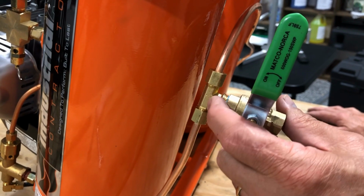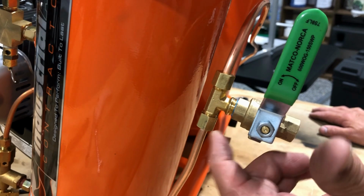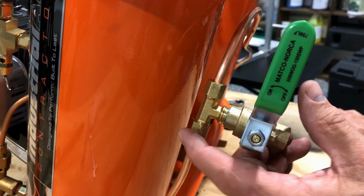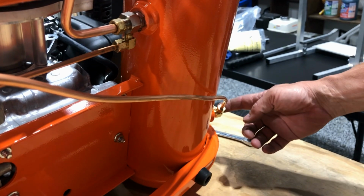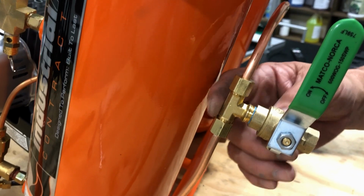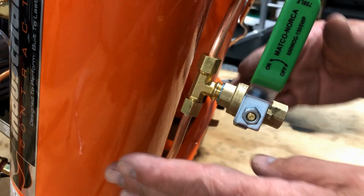This is going to be the hardest one to find. Sometimes you have to look for these, but this reduces the number of fittings. So this threads right into your 1/4 inch valve, 1/4 inch by 1/4 inch tubing. These are compressions, and then, like I said, the same fitting over here. So you got 2 90 NPT by compressions, 1 T NPT on the T side, and the cross members are compression, and a 1/4 inch turn ball valve. And then if you want to bring it up, you can always put more tubing and bring it up higher.